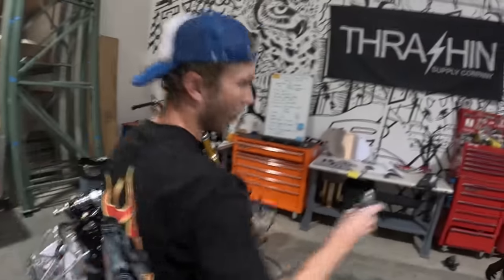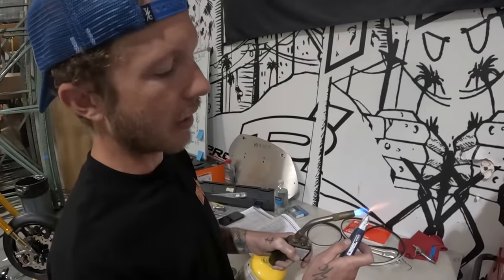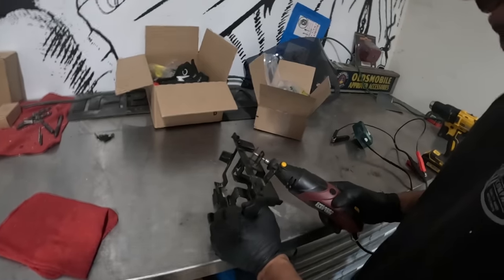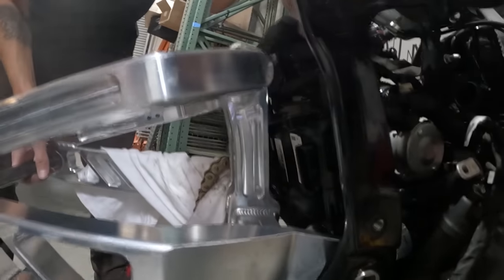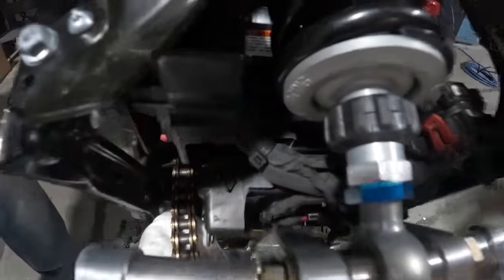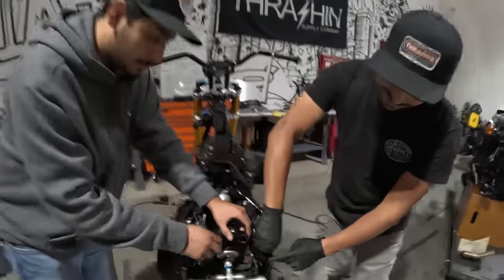This plug — if you want to keep it sealed, the corners hold it and you have the areas to screw it back. We need to cut off the majority of this bulk but leave the four corners and mounting holes so the swing arm has enough room to pivot. I'd get the tip red hot. Blade gave out — we're just gonna do the last two inches with the snips. So now we unexpectedly had to trim the BCM plastic cage behind the battery — way more travel, rerouted some wires, zip-tied it on, did a couple little rerouting cleanups. I think we're happy with it.